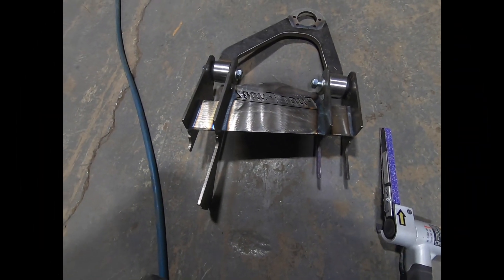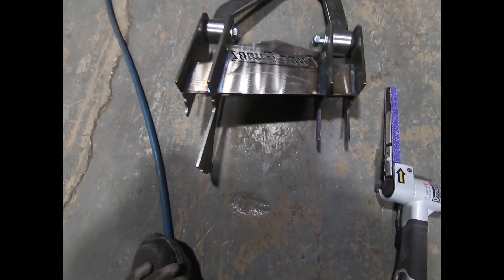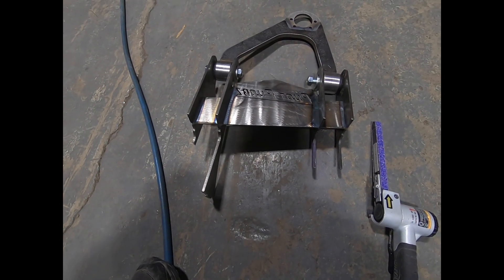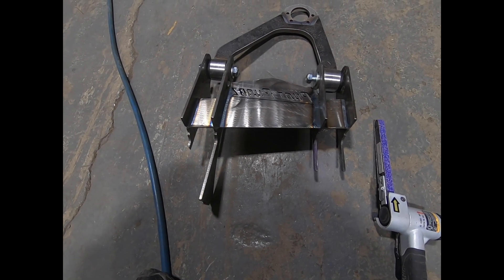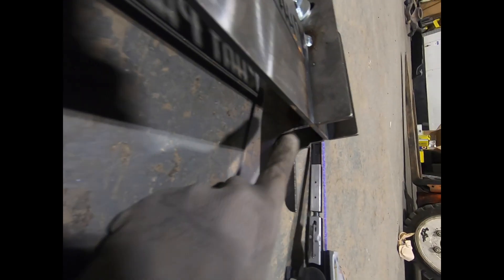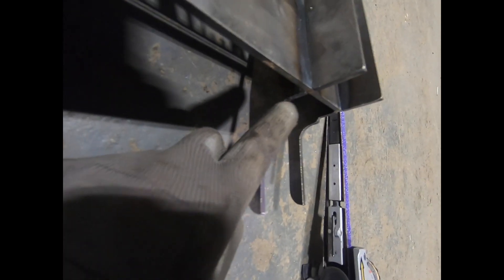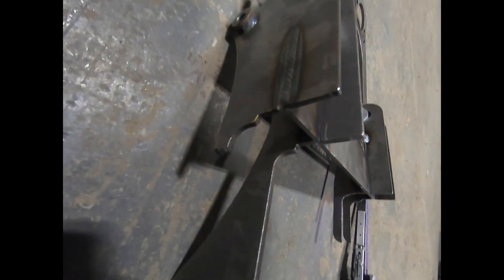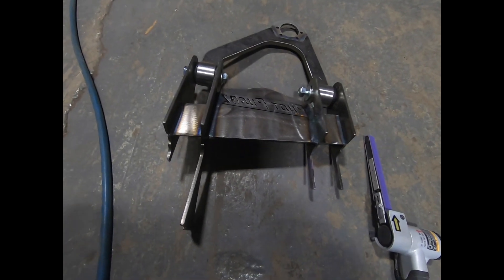Here is the right side upper control arm mount — this is actually a left side off a Dodge Ram, but we're gonna put it on the right side because with this angle it sits a lot better on the frame, giving us about 0.4 degrees of caster. Right now we're taking these little nibs off because this is not on a Dodge Ram so they're in the way. I took this one off and just ground this one down — this side actually lines up nice so we're gonna leave those on. Once this lines up we'll be putting it on.